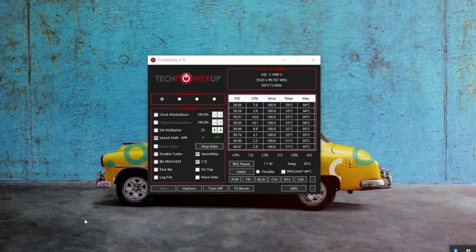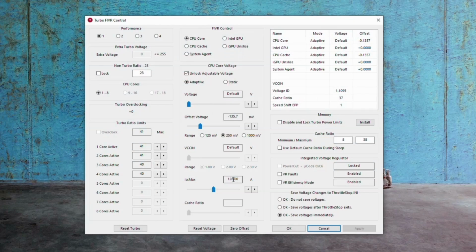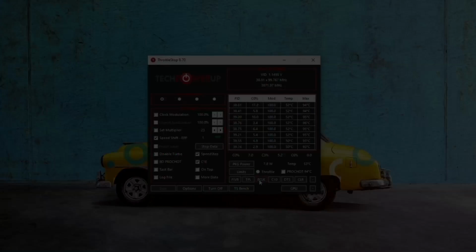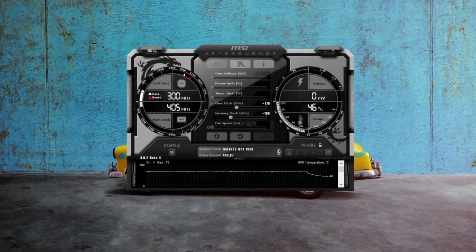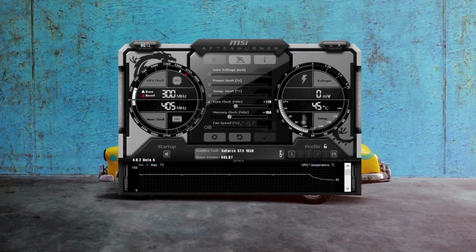Okay, so going back to that single channel RAM, what can we do to improve performance? Well, fortunately, Lenovo hasn't stopped undervolting, so this is the first thing you should do. I set mine at minus 135 millivolts. You can also overclock the graphics card. Now your system may have to use different settings, but even this is worthwhile doing.